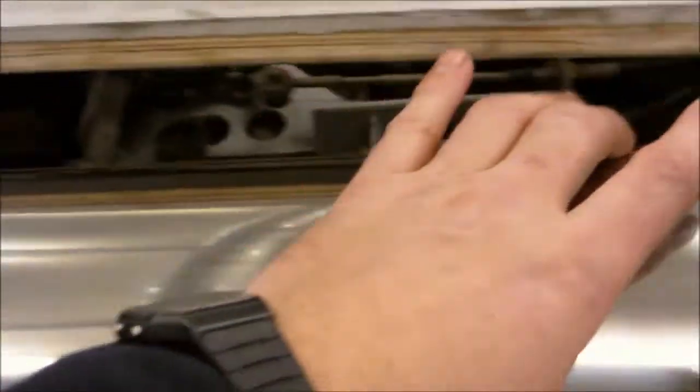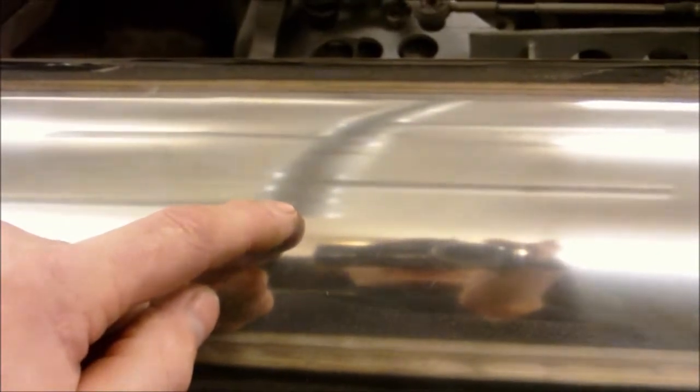In here, it's an open channel and then goes to a baffle box. In the open channel and the baffle box, the exhaust gases tend to mix up and cross over, which gives me my tuning properties for a tuning box for the V8. And it also should give a bit of a raspy sound, taking away, hopefully, the deep throaty sound that you get with a standard V8.